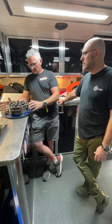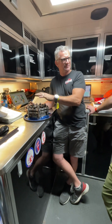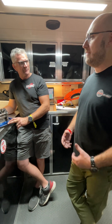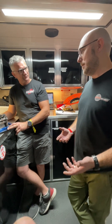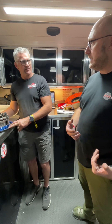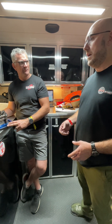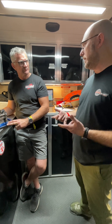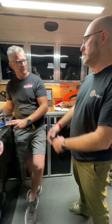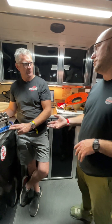Typically when you're done in the pits and heading up for the run, you're not going to make any more adjustments. On a pro stock car they will in the staging lanes, but it's easier for us because we have power management those guys don't. For the pro stock car, you've got a starting line RPM and that's it — it's naturally aspirated, that's all the power you have. With a supercharged car like these, if I raise or lower the RPM, I'm also raising or lowering the boost, and I can play with ignition timing. You have to be cognizant that it's a series of dependent events — if you change the engine's power level, it changes the way the clutch behaves. We've got a window we know we can get away with, and past that you really need a clutch change.